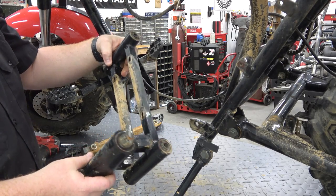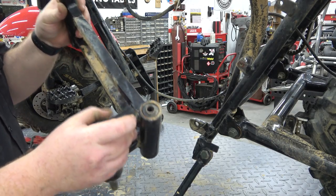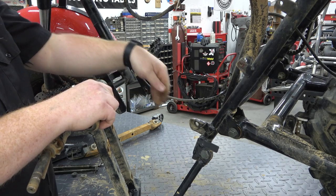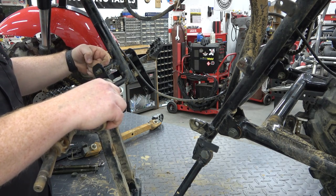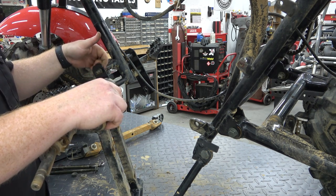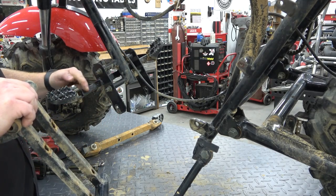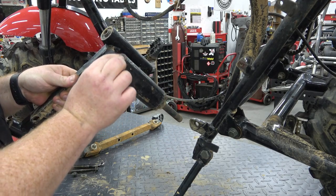There's that swing arm — you can see those rubber bushings in there. We're going to make sure to clean the backsides of the tabs up on front and rear, and I'm going to weld these stubs as well. There's no reason to leave it just like this. We'll leave the bolts in it just to make sure, but we can take these bolts out now, drop this, go ahead and cut all these foot pegs off, and then press these out and replace these bearings.